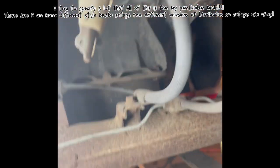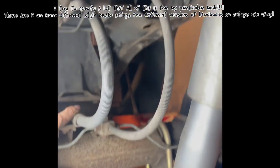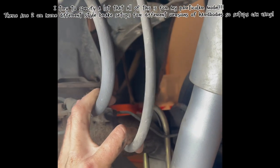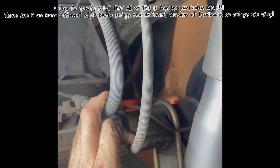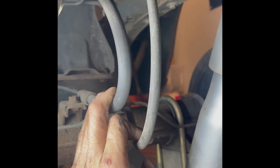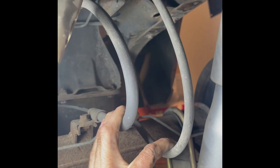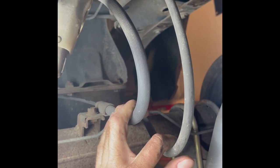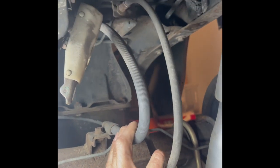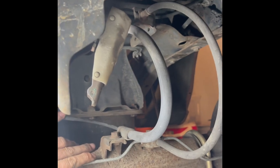So doing this, obviously you've got your ABS connector you have to pull off here, but your disc brake... For a '95 short bed, four cylinder, two wheel drive, and some of the other hard bodies, I think four wheel drive is the exception. It doesn't have a brake proportioning valve when it has this load sensing valve in there.